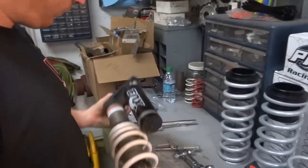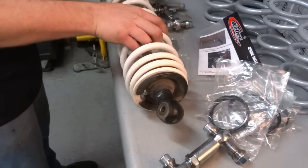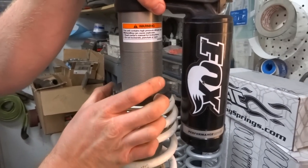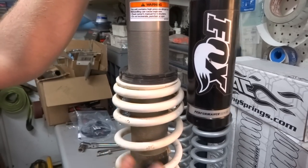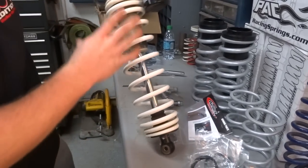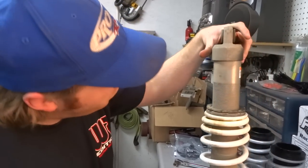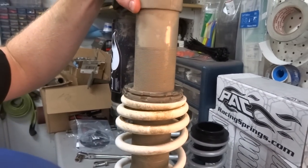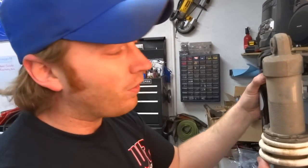So, pretty basic, right? There's a retainer cup on the bottom - there's spring pressure on it, so you can't get it off yet. You've got to take your preload nuts - there's two of them, they're jammed together. Unjam the top one, thread the preload nuts up, take the pressure off the spring. Then you'll be able to slide this cup out, spring comes off, and then we'll replace it with the new hardware. Do yourself a big favor and clean the threads up a little bit first before you go trying to thread those nuts all the way off the shock body. That'll make your life hard.